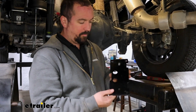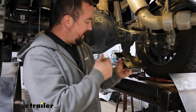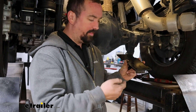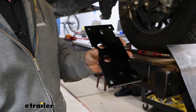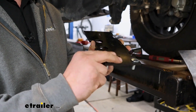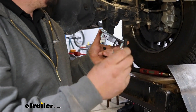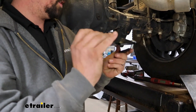Put the flathead screwdriver on the lip, make sure the long side isn't sticking out, get it orientated, then twist the flathead to pry it in place — that allows us to get our hardware up later. Now grab your upper mounting plate. On the passenger side, the rounded portion needs to face towards the inside; the driver's side is just the inverse. There's also an elongated hole — make sure that's facing towards the cab of the truck. Take the carriage bolts from the hardware kit, drop these in, then thread on the button head screws into those new brackets.